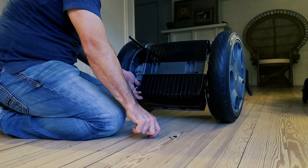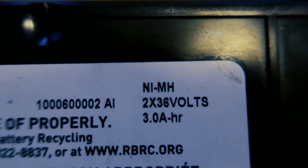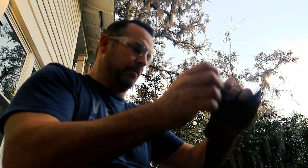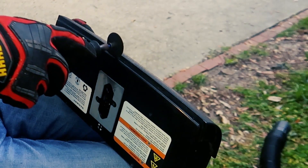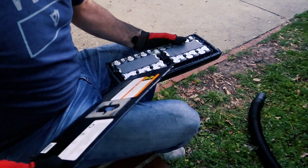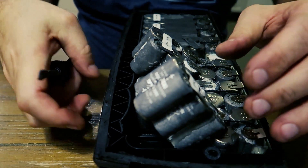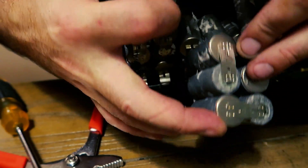Removing the batteries from the Segway is very simple. I just laid the Segway over on its side — there are eight hex keys you remove and then the batteries pop right off. Each battery has two 36-volt outputs for a total of 72 volts per battery pack, and a quick test with the voltmeter confirmed my suspicions: I was only getting 2.9 volts out of this battery after charging it all night. I got out my Dremel with personal protective equipment and cut off the top of the battery, staying close to the edge so I didn't cut any circuit boards. The part that came next was pure hell — Segway used some kind of industrial glue that people nicknamed 'gorilla snot.' This stuff is serious. After 16 years in there, I couldn't get these batteries out for the life of me and I completely ruined them, but all I cared about was not damaging the circuit board.